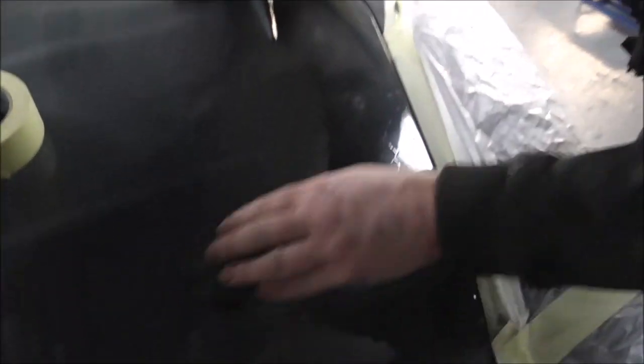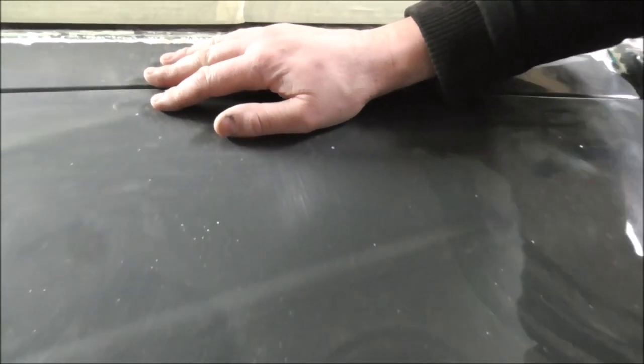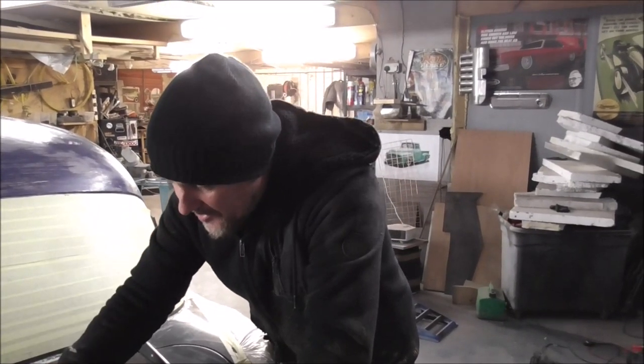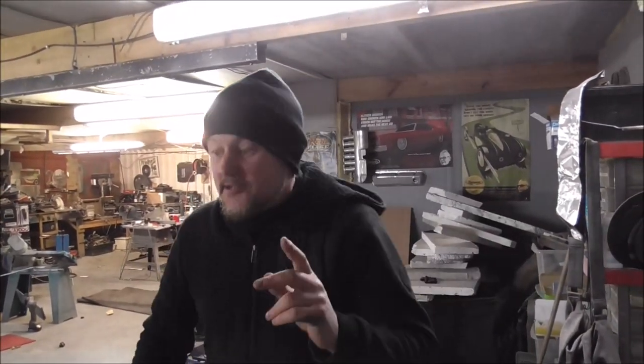I'm going to take a look at the boot. Now the boot is not quite as bad - this is crazing but the paint is sound, it's not going anywhere, and I've had a scratch just there just to make sure. However I've seen a few blisters up here which I think might be rust so I'll be grinding a little bit deeper there. But I think for now if I just go over this with a bit of 40 grit and get all this off, that will start to get me down to a decent base.